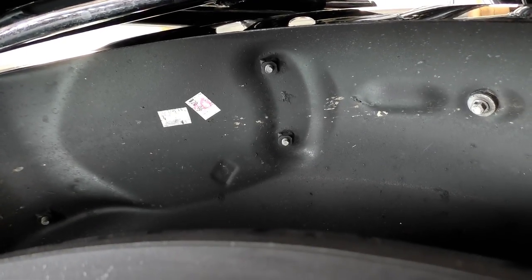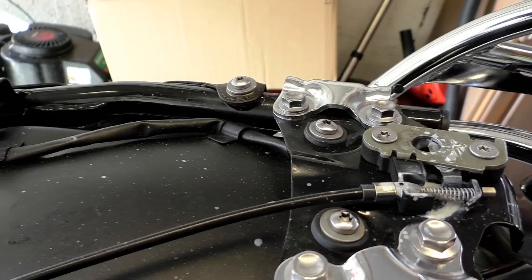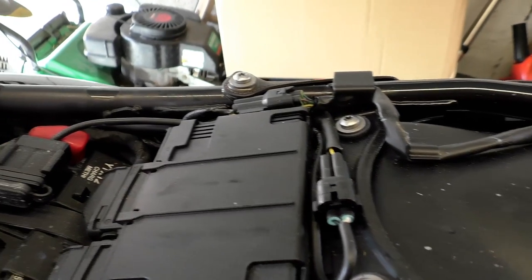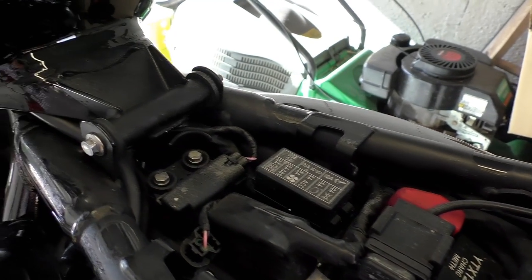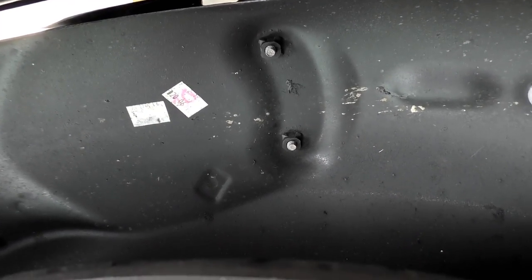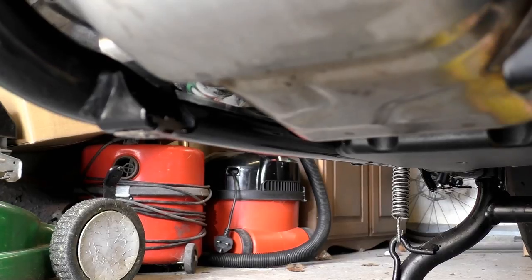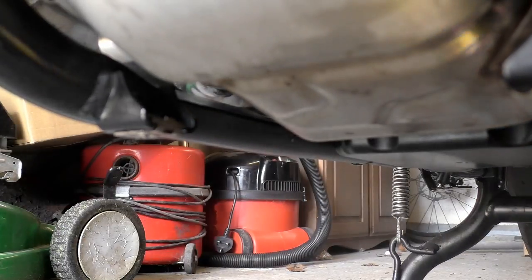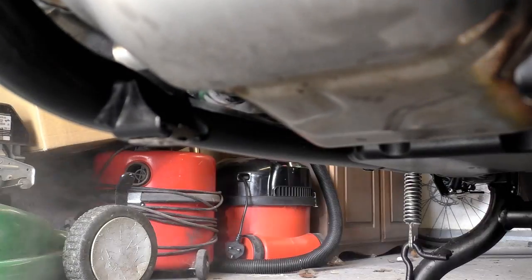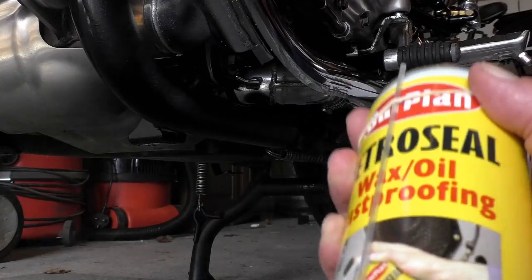The first thing I did when I got the bike home was treat the inside of the mudguard with Wax Oil, along with the top of the mudguard — the part hidden by the seat — and the top rails of the chassis. These were treated over a year ago. The inside of the mudguard has picked up very little dirt and everything is corrosion-free; even the paper stickers are preserved. To prepare the bike for winter, I ordinarily treat the wheel rims, kickstand, side stand, lower half of the frame, and the rear swing arm.